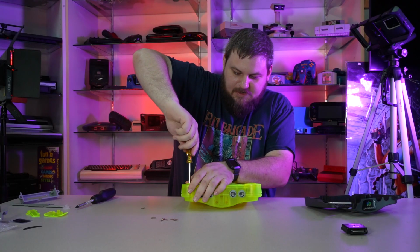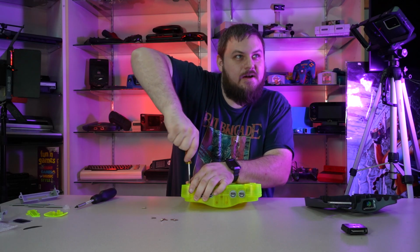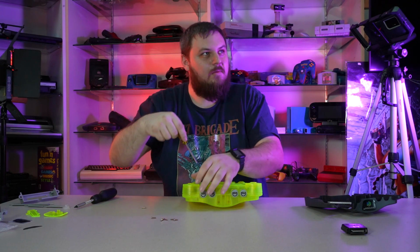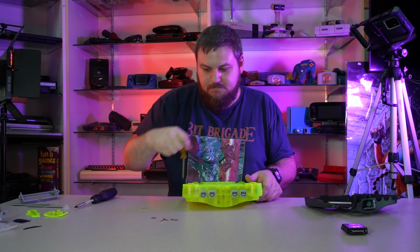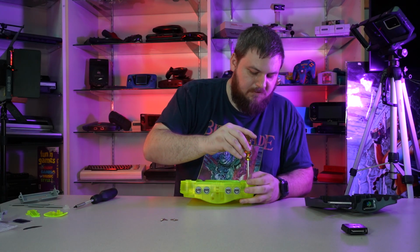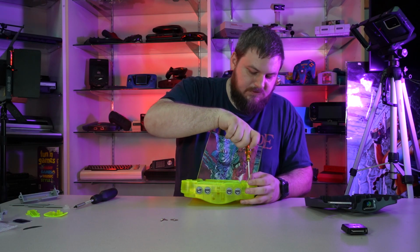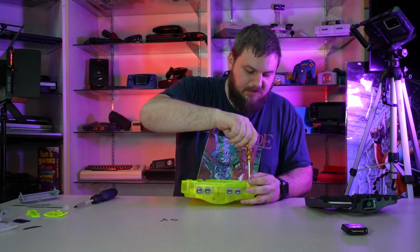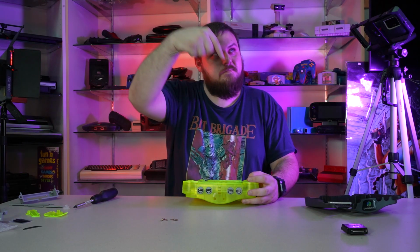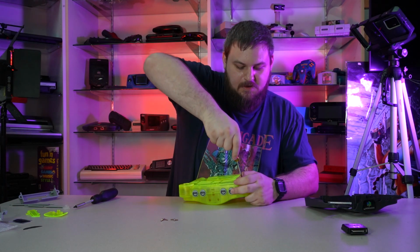And then when doing the outside, I don't like to do it kind of like how when you're changing the tire out. I like to get it started and a little bit snug, and then get them all that way, and then tighten them in opposite ends. One thing that's very easy to do, and you make sure you don't want to do when doing this outer shell, is those screws. You can start tightening them down and they won't be completely straight going threaded through, and it's easy to like thread them in going kind of slanted. Yep. Definitely don't want to do that.